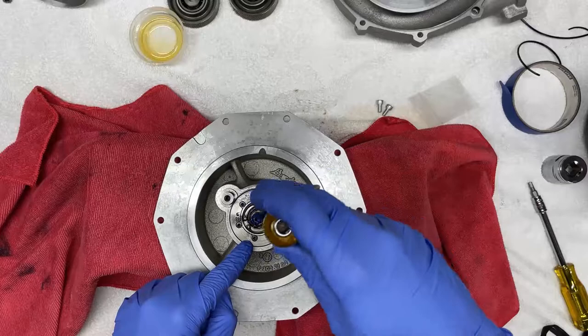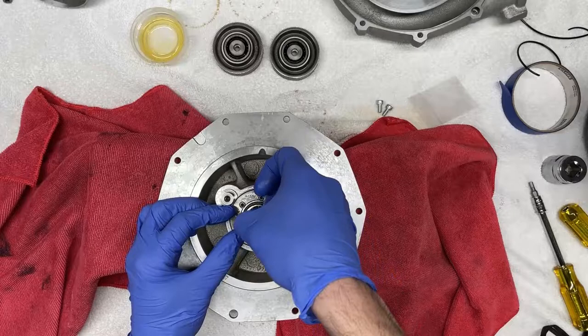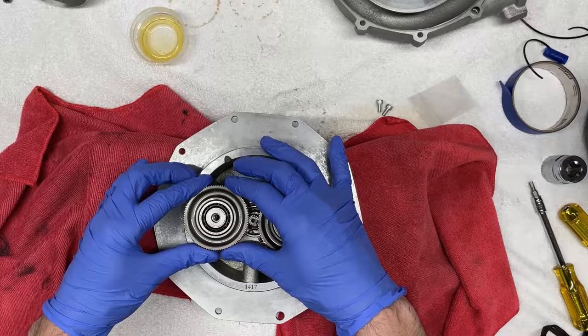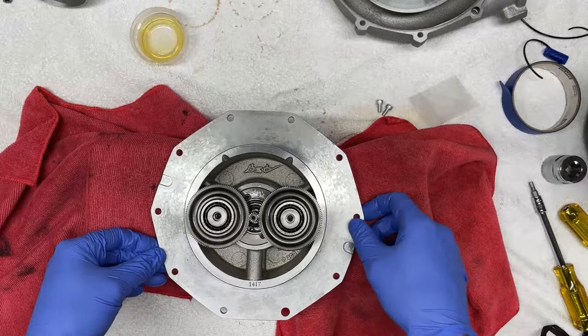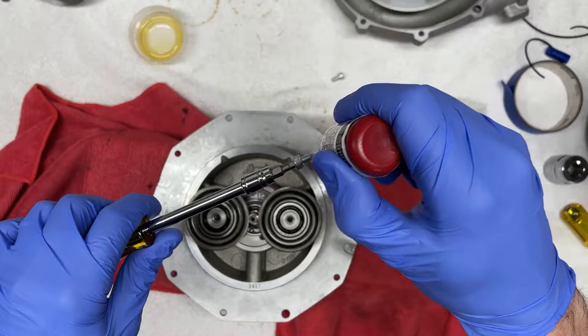The next thing we're going to do is install the 2 helical gears. To do that, we're going to remove this protective tape, like so. And then we're ready to install these gears. We'll do one by one. Kind of gently pressing it in. I'm going to do the other one. Ensuring that they are concentric, which really helps with the installation. Okay, so now we can install these fasteners. Again, we're going to use a 4mm hex bit, and we're going to apply some blue Loctite. Like so.